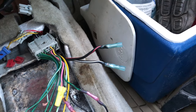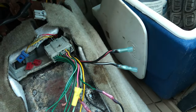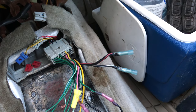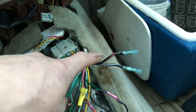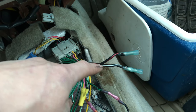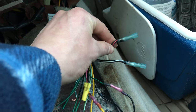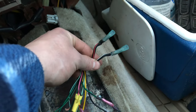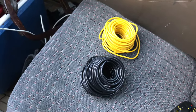So it's best to wire this up to your clutch safety switch. I got the butt connectors all connected up onto this heavy gauge wiring. Make sure you get the right size butt connectors — this was a 14 to 16 gauge connector. I believe it was 14 gauge wire. It wouldn't hurt to go a little bit bigger; it was a snug fit. So, 14 to 16 gauge butt connectors. Now let's extend the wires onto here.